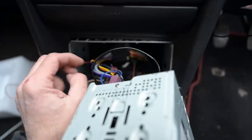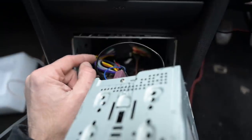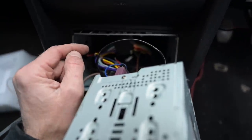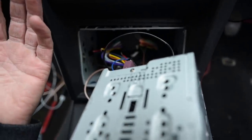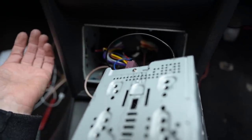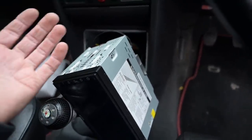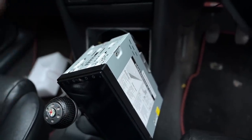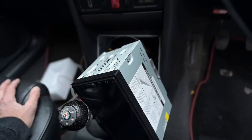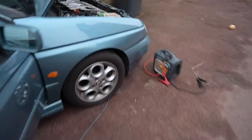Even though Autototo were clever giving you two versions of the plug so depending on how your car manufacturer wired the red and yellow, Alfa have left them both as always on. I investigated by cutting one of the looms — since I've got two it doesn't matter — but it will only work if both the red and yellow are intact, so you can't just cut the accessory wire. The old radio in here was a dumb 1990s Alpine that didn't draw any power, so it wasn't really an issue, though this car was always getting through batteries anyway.